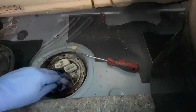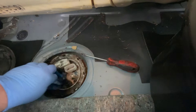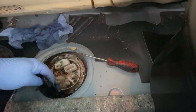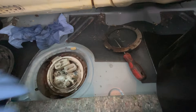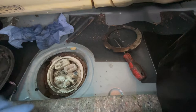Just taking up some fuel here. There's a clip on this side and one on the other side on the rounded area. Now we've got those out of the way, we can undo the ring, take it away and get to the fuel pump. We need to remember the orientation of where the pump sits. Also, because this is a VR6, the fuel tank is a saddle tank — there's one pump this side and a connector that goes from one side to the other on the passenger side.